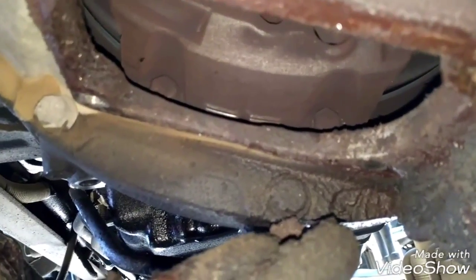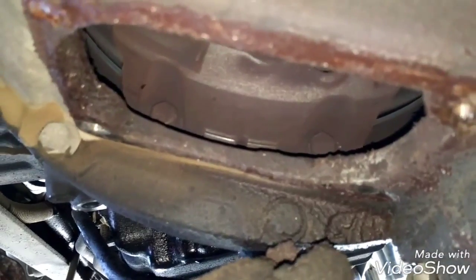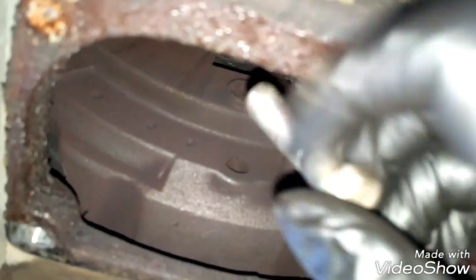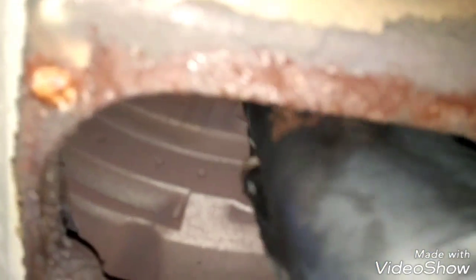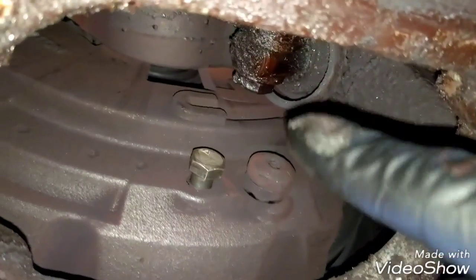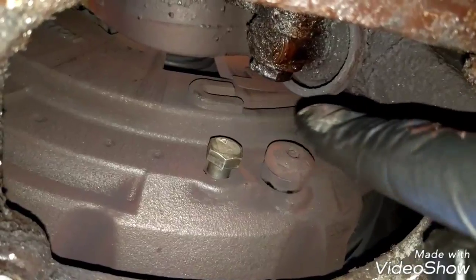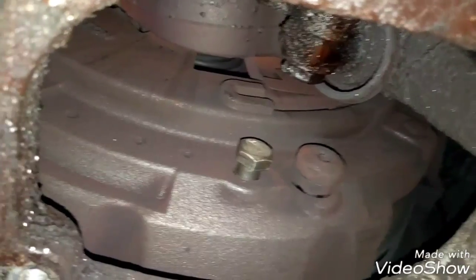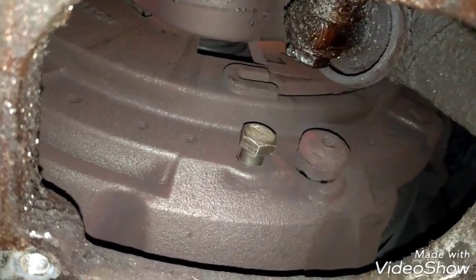One more thing about the clutch: if for any reason you're planning to reuse the clutch, you're going to insert a bolt on here like this and screw it in, to tie the bolt and prevent the press from becoming misadjusted. Because we have an Eaton Solo clutch — you can see that line over there, that's an Eaton Solo. If you have an easy pedal, the one you can adjust manually, you don't have to do this if you're planning to reuse the clutch.